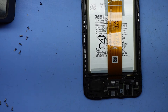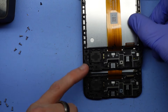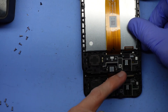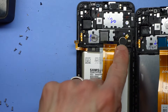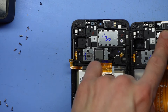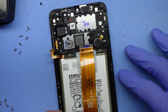Next up we want to compare what we have here with what we've got on the replacement. As mentioned, this is a service pack so it contains a lot of little things that normally you wouldn't have. There's some foam here, the loudspeaker is already there so we don't have to move that, the little microphone duct is already there. I do have to remove the battery and the vibrating motor. The earpiece speaker is already there, and I don't have to worry about the small thermal pad, so I'll proceed.